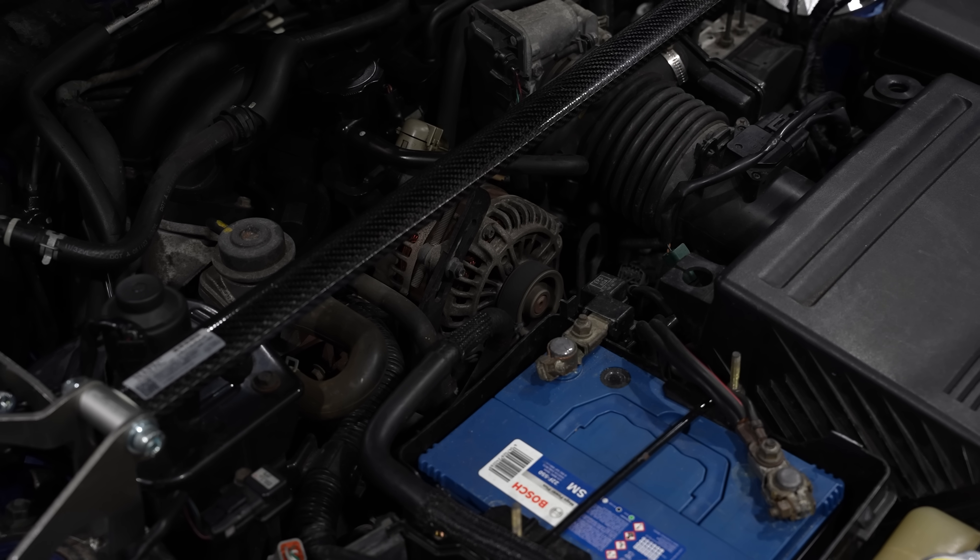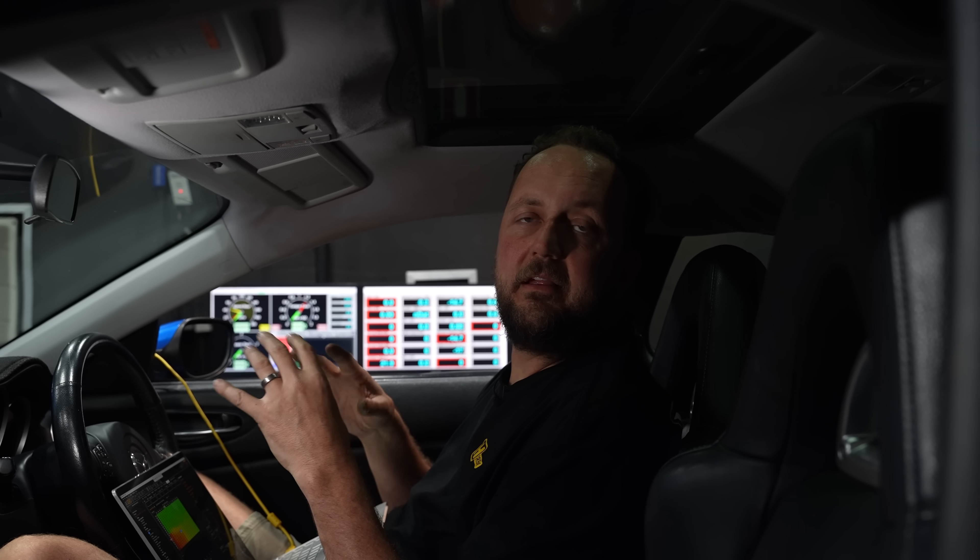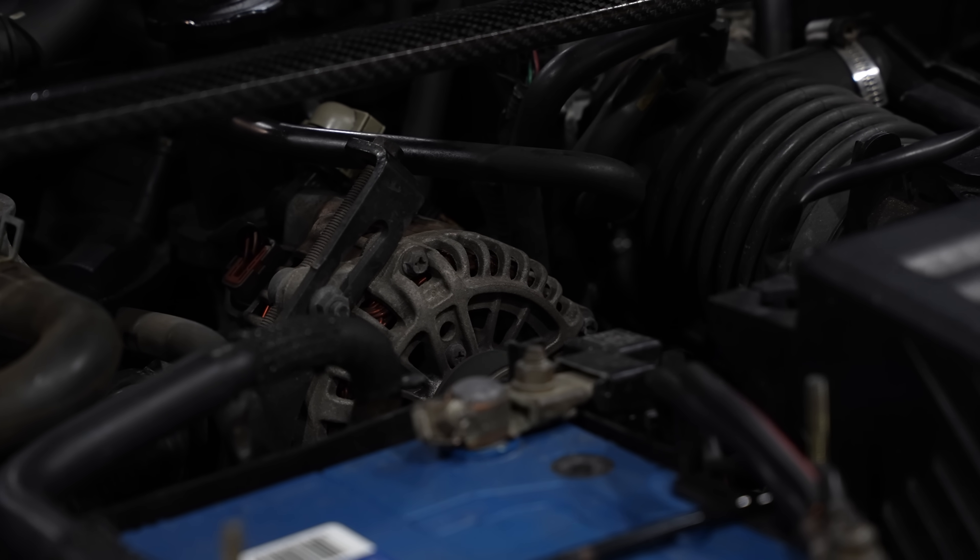And she's running and away. This is what we're expecting out of the system from the wizard — it sets up the ignition coils, the engine type, the injector sizes, and with the O2 sensor in, all of our long terms are turned on. The longer the engine runs, the better the idle quality and air-to-fuel ratios will get. It's hardest to make that first 100 kilowatts, and that includes startup. It's a plug-in ECU so all inputs, outputs, triggering systems, and ignition information are configured — hit the key and it starts and idles using the electronic throttle. Half the battle is already won. The part I enjoy most is sitting on the dyno extracting maximum torque across all load and RPM references — that's what I'll be doing for the rest of the afternoon. Thanks very much for watching. My name's Scott — catch you next time.